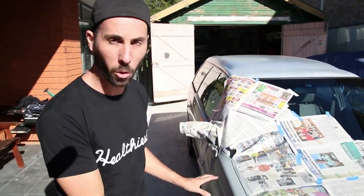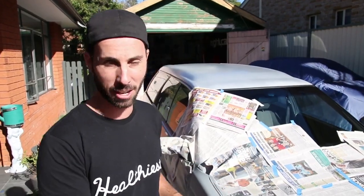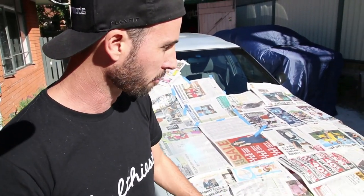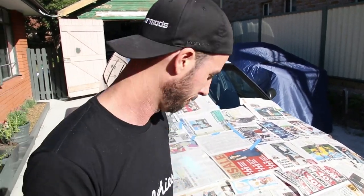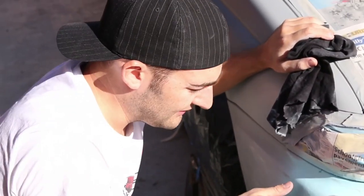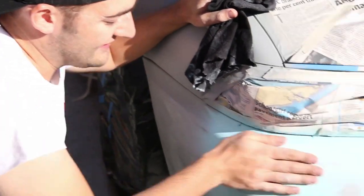So this is where we're at. This front quarter panel now has around four coats of primer on it. Next up we're going to rub that back, then it gets base coat, and then we do the clear coat. The high-filled primer is filling in all the little nicks and crannies. As always, it's best to check it with your hand to make sure it's flat, because sometimes it might look flat but when you feel it you can feel a little bump. The idea with the filler primer is to get it as flat as possible and just sand it back. It'll take a couple of goes, but it'll be totally worth it when you've done the top coat.